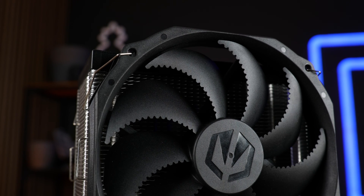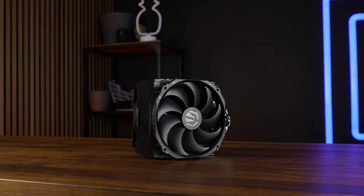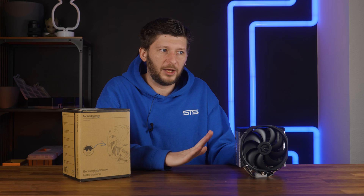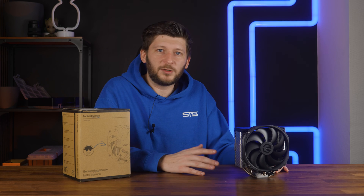Compatibility is also fine — 159mm is fine and no RAM restrictions because the whole thing is pushed to the back. The brute performance is okay at best; for a single tower, it's really okay. But the noise — that thing is almost unhearable under all circumstances. I believe this is an excellent choice for quiet builds. If you have a high power chip like a 14700K or 7800X3D, the fans will be stuck at max fan speed basically all the time, which isn't the biggest problem as they are nearly unhearable. But do you really want them ramping up and staying there 24/7? I don't think so. This is more adequate for non-K or non-X CPUs — the type of stuff that burns 100 to 150 watts under full load. For those use cases, the cooler will always be whispering quiet, and once it has to work, you won't really notice it anyway. For higher TDP applications — a 14700K with a Cinebench fetish — the thing did 250 watts quite well, but I wouldn't recommend that considering the fan would just be spinning at max speed all the time.